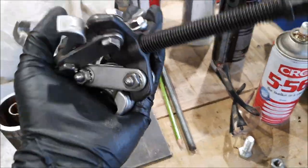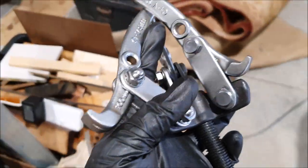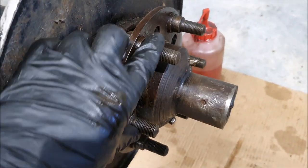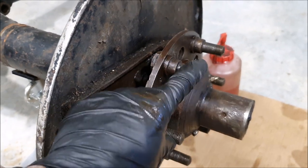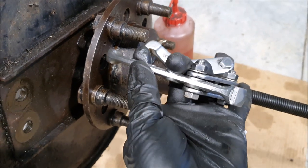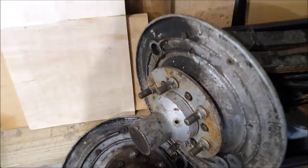Hopefully that means I can pull the half shafts out and also the front hubs off. This is a gear puller — it isn't big enough to fit over the ends of the hubs. What I think I'll do instead, since these are six-stud wheels, is make three little flat bar straps that'll fit over the studs, bolted on. Then my puller will be big enough to grip the edges of those flat straps and I can pull on this.